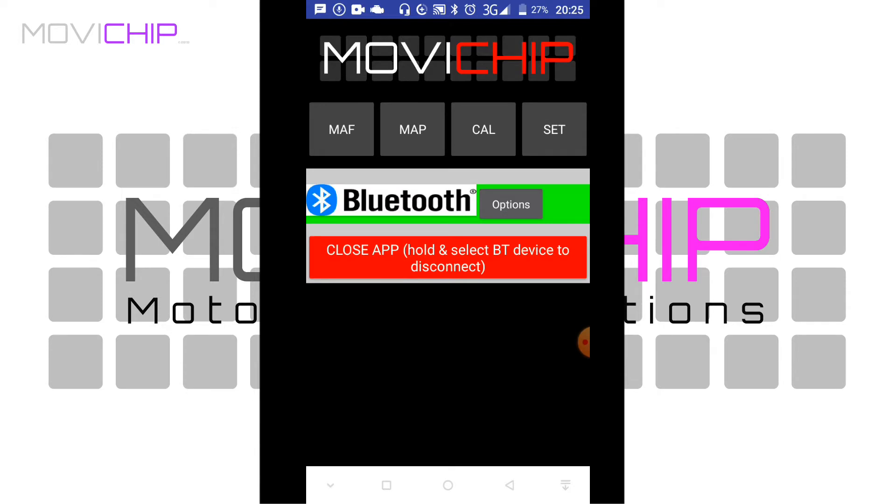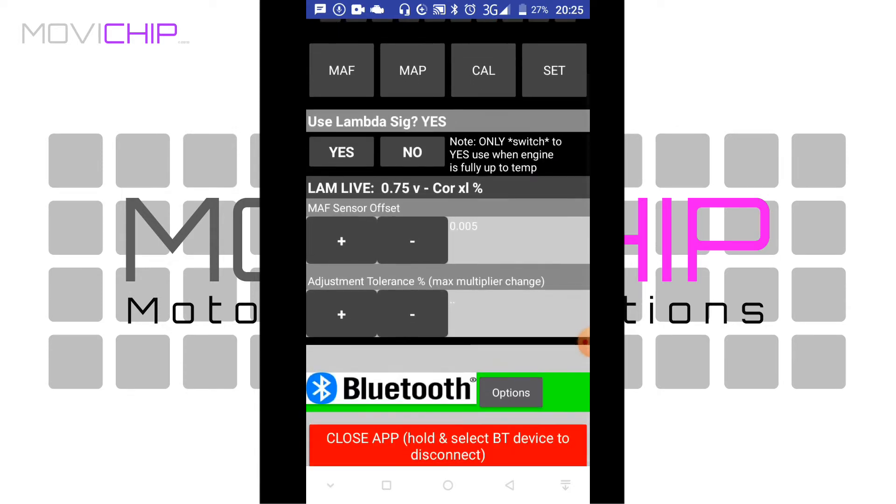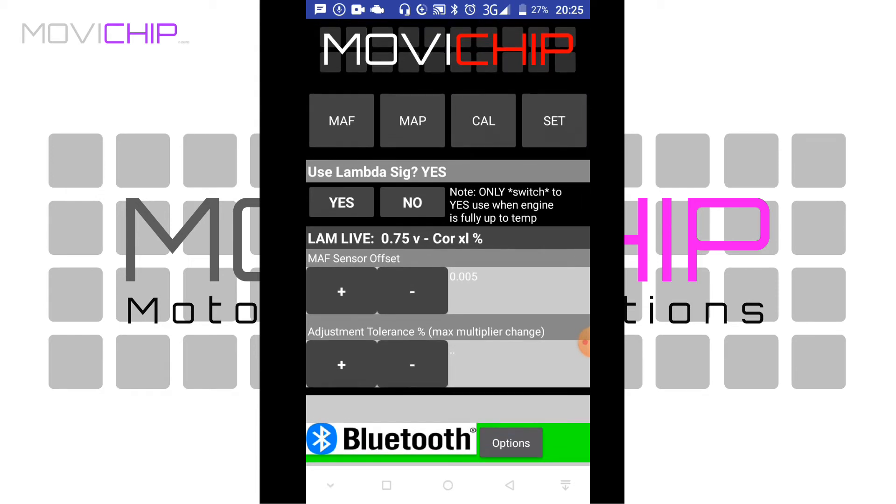We can just go into the car menu briefly. This is where you set it to use the auto-tune function or not. If you've connected the unit to a wideband lambda sensor, you can use the unit to automatically tune the MAF sensor signal to get the AFR that you choose — we'll come to how you choose the AFR in a minute. At the moment we've got 'use lambda' across the top — you can choose yes or no. If it's yes, it's going to use the lambda; if it's no, it's just going to use the fixed values that you put in.